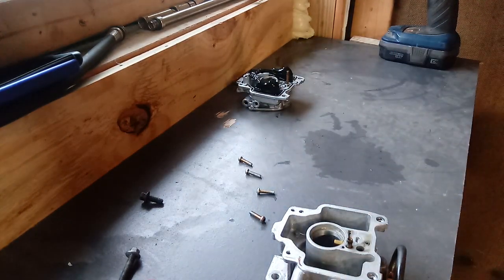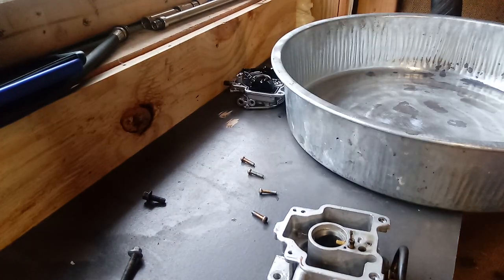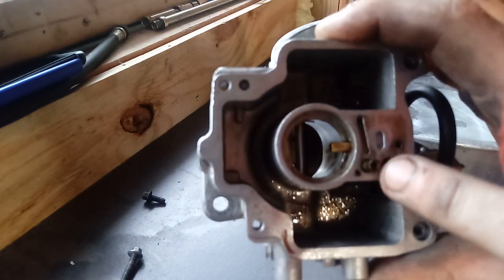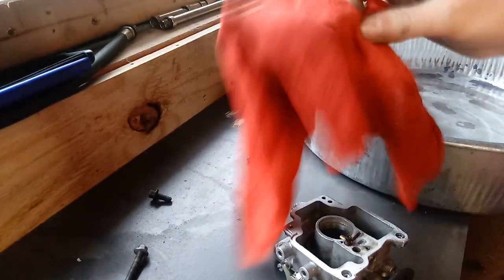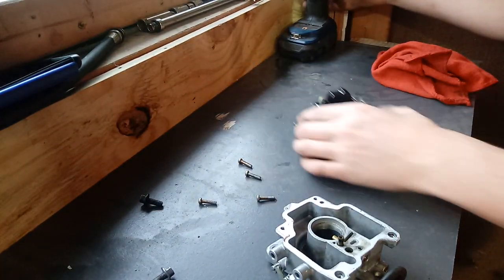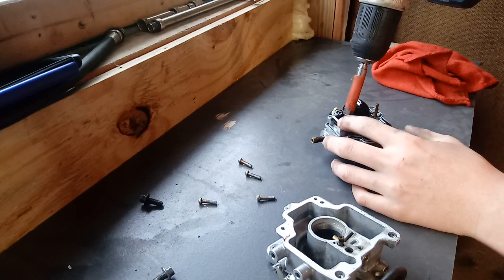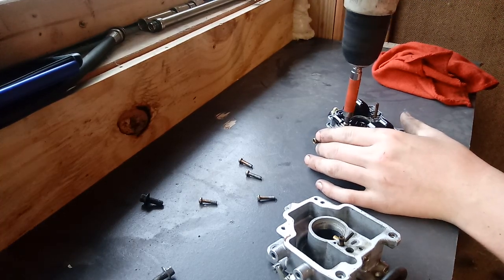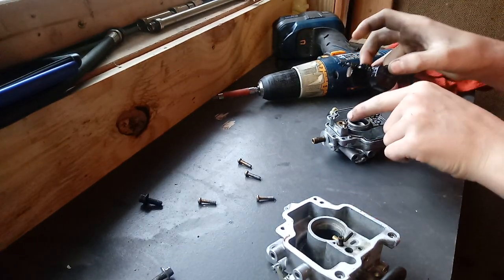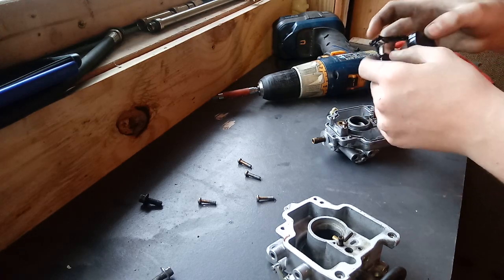So I'm going to go empty this pan. But if your engine starts and it's not in the mower — like all the safety features are disconnected — and it stops running after a second, then it's probably a carburetor flow issue, because this thing is not looking so good. Make sure you have a clean towel to wipe any parts down and a clean pan. I can already see some dirt floating around in the float pan area.